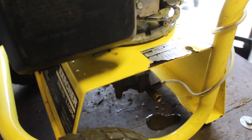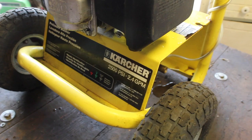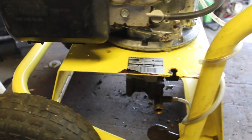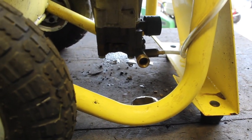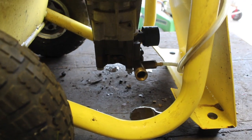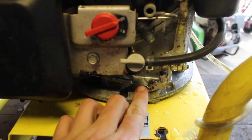I tried out the pump itself while the engine was surging — it would gain and release pressure just fine. At low RPMs the pressure went down, at high RPMs pressure went up. I don't think it's the pump, because if it was the pump, the engine speed wouldn't fluctuate. So I started to look at this spring right here.